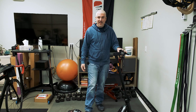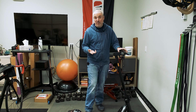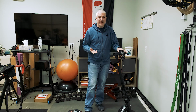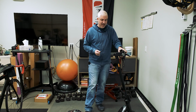unless you grab some brake. The first time I gave the brakes a little grab, I think it combines regenerative with the disc brake. So I was surprised at the stopping power. So, be ready for that as part of that initial 200-meter ride. I would do some braking, mess around with that a little bit, get accustomed to it before you're up to speed, or you get in a dangerous situation where you really need to grab a handful of brakes.